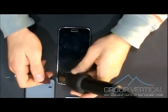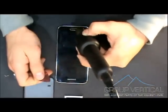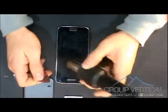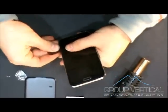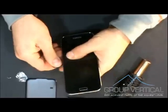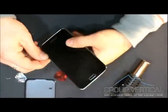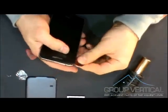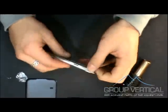In order to take the screen off and loosen up the adhesive, you're going to want to use a heating gun or a hairdryer. You're going to want to do this for quite a long time because it's on there very good, to avoid breaking your screen. As you're doing this, you're going to want to take some guitar picks or cards, whatever you can get your hands on, and start prying it off. You want to make sure you start from the top — you don't want to pry from the bottom because there are some cables connected you could rip.